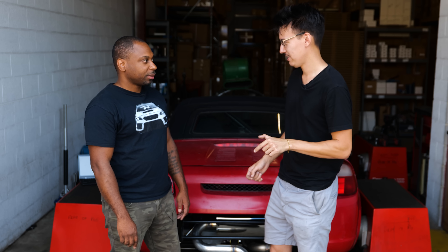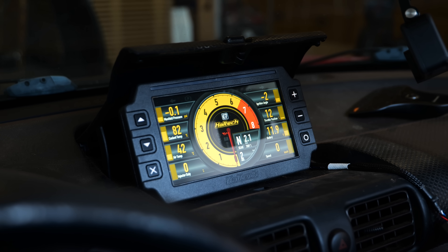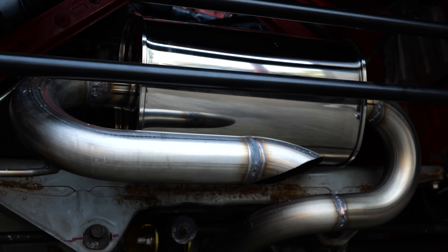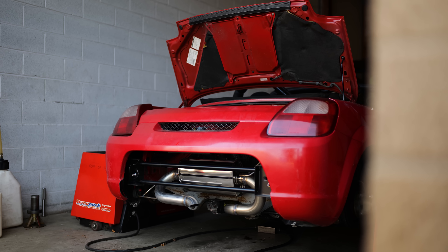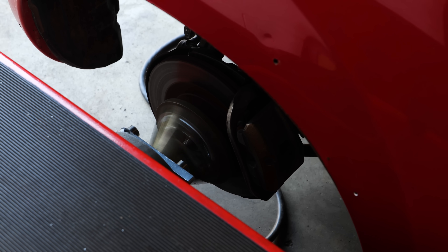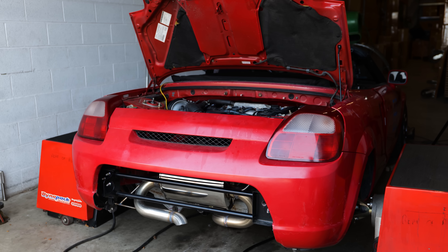That's with a hybrid motor, but it was tuned for fuel efficiency — we're throwing all that out the window. We've taken Toyota's own parts and used them against them; everything they engineered to be efficient, we're turning into horsepower. Hopefully it doesn't literally backfire on us. We're going to try a nice conservative pull just to make sure everything's okay and give us a decent baseline. That's 162.8 foot-pounds and 150.5 horsepower. The base map is actually pretty good — I think it's going to do okay. We're going to make a pull here; I'm hoping it'll sneak over 200.